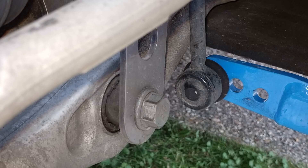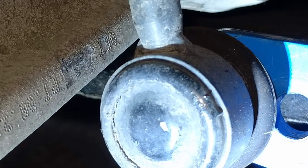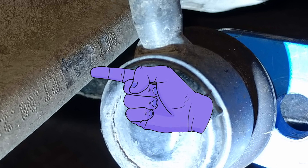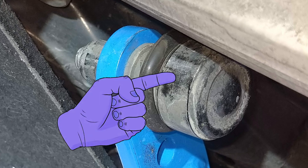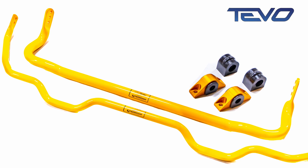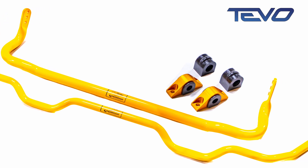Here's another aftermarket Model 3 anti-roll bar — I just wanted to show you a couple of things worth noting. First of all, it had welded ends, so as I've said before, that really is to be avoided. But it also had another problem: if we look close up from a different angle, we can see a witness mark showing that something's rubbing against the control arm near the roll bar. From the other side, we can see it's actually the end of the drop link — which means the anti-roll bar was just made incorrectly, to the wrong dimensions. It's too long. So even though they're a very simple item, there's good and bad. Have a look at the engineering before you buy. Don't just go on a brand name.